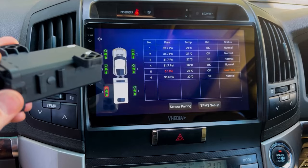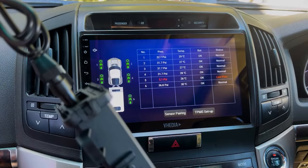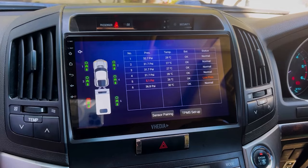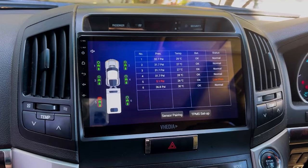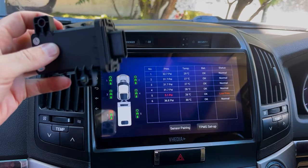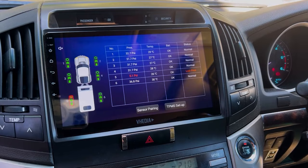If not getting reliable signal, or it's a bigger caravan, use the repeater — it ensures every signal comes through reliably. Zip-tie the repeater in a test location first; you can even power it with a 9-volt battery for initial testing. If still getting no signal, move the repeater further back. Think of it as line of sight — it needs to 'see' the tires, so avoid obstructions like a large water tank.